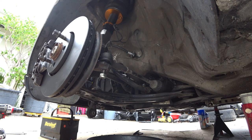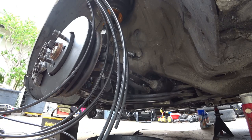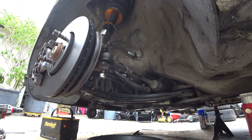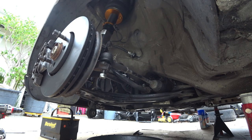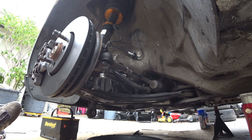First thing you need to do is get yourself about 30 to 40 feet of DOT air line, quarter inch. And if you watched my video previously, you need to get yourself quarter inch fittings with a quarter inch push-to-fit air parts. I picked these up at SoCal Suspensions in El Cajon, but you can find these parts at hydraulic stores if you can't get to an air suspension place. It's not hard to find these little parts, but you are going to need them.